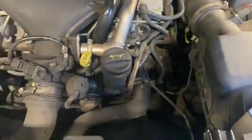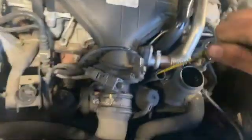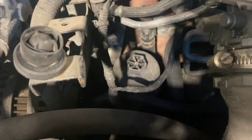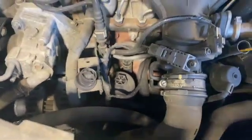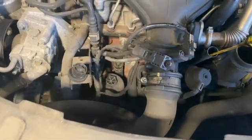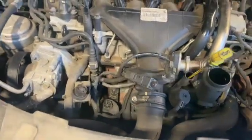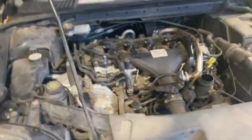That's the air filter change done — fairly straightforward job on these. The next thing I'm going to do is take the oil cap off, pull the oil dipstick out, and then we're going to take the oil filter out. It's just at the front here — got this plastic cap; it's an element-style oil filter so it's actually inside that cap. You want a 27mm socket to take that off. I've put links in the description below to all the parts and part numbers, and some of the tools used as well.